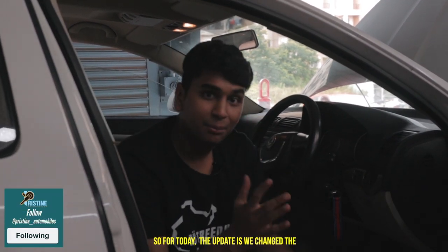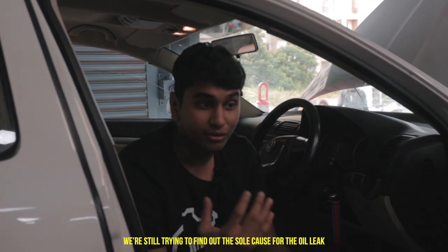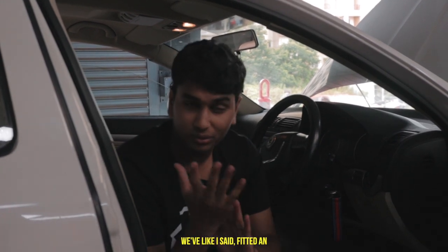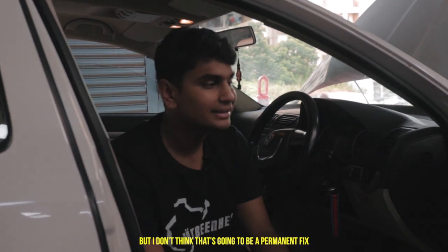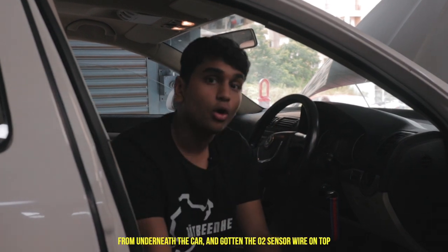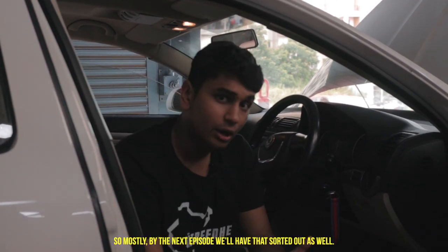So for today, the update is we changed the ignition coils to R8 ignition coils. We've changed the spark plugs to Performance Iridium spark plugs, and we're still trying to find out the sole cause for the oil leak. Like I said, we did an O-ring for now just to stop it temporarily, but I don't think that's going to be a permanent fix. We've removed the wire from underneath the car and gotten the O2 sensor wire on top onto the engine bay. So mostly by the next episode, we'll have that sorted out as well.